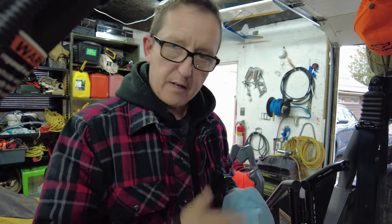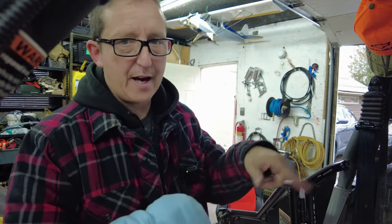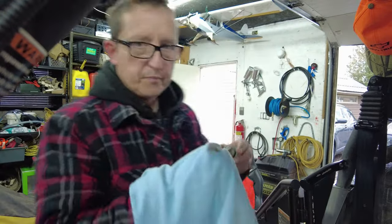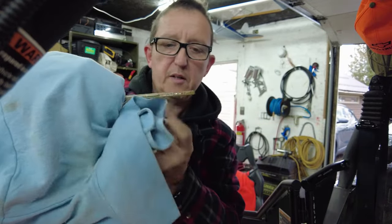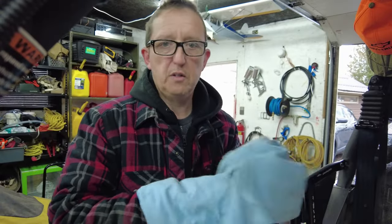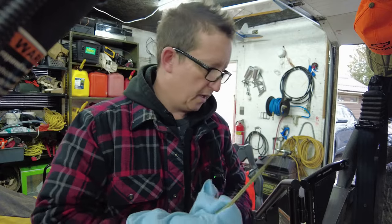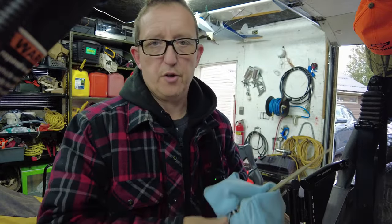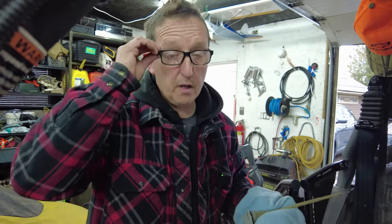We have no leaks. Now I'm going to pull the dipstick one last time. I'm just going to double check that actual level. I don't know if you guys can see that. It's probably pretty hard to see, but we are at the full mark right here, and that is exactly where I wanted it. Not over full, not under full, in the safe zone, top of the safe zone, and that allows for the engine to burn a little bit of oil, because every four-stroke internal combustion engine does use oil. I mean, the rings can't bring it all down.